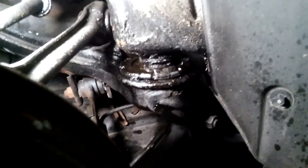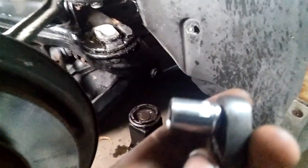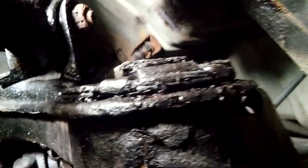We're going to lower the jack, slowly. We have to pry this thing off because it's stuck. That thing is lowered on that side too. On this side you have to do additional work — grab a 10mm socket. As you can see, this plastic cover right here, you have to remove that. So you see those two plastic nuts and there's one on the bottom, so remove those — actually just remove one nut.